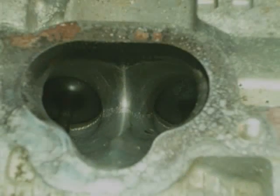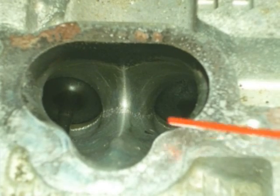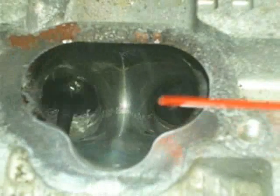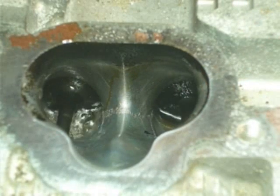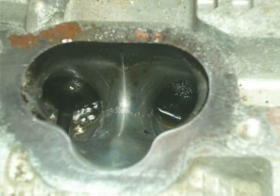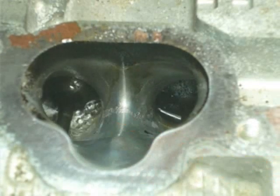Here's why I kind of hate leak-down tests. You can hear a leak — it's coming from both the exhaust and intake valve. Let's wait and see. I'm putting brake cleaner on now — can you see all that bubbling? I'm going to put more on.